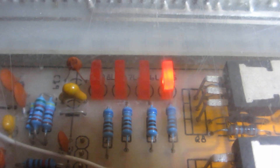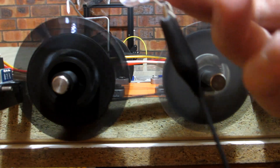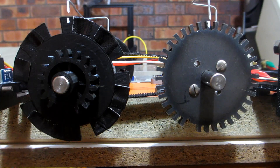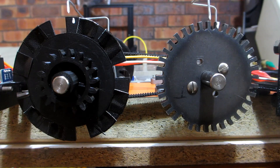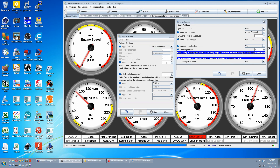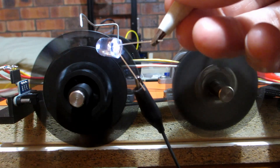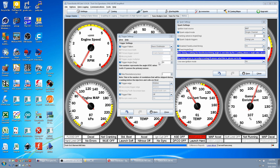Only ignition channel 1 is firing. The result is 4 ignition pulses down the same ignition channel, but with no fixed starting point due to there not being any location pulse. The offset is set the same way: number of degrees clockwise from top dead center to the first tooth, then observe how many crank degrees it moved and enter that into the trigger angle. For demonstration, punching in 90 degrees offset gives 90 crank degrees, which is 45 degrees on the cam wheel. This 90-degree offset is unreasonable for a distributor — only small amounts should be used.